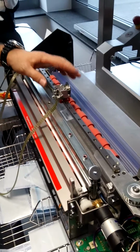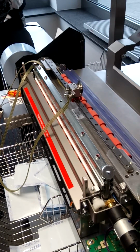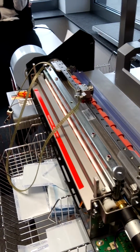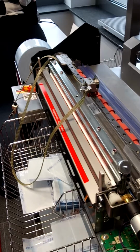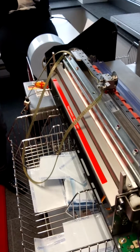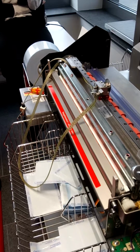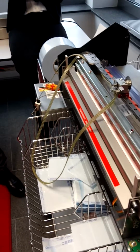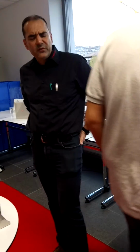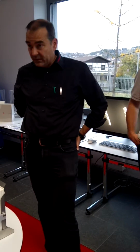Great. Then we have the cutting assembly here, and that was the component I showed to you this morning that has to be re-engineered to be a little bit larger, with a sharper knife and less angle or a flatter curve for the belt that is actually driving the knife, and therefore we reduced wear and tear a lot. Also from Asia we received news that at 30,000 cycles the knife belt got damaged.